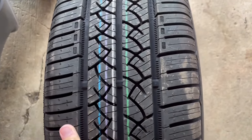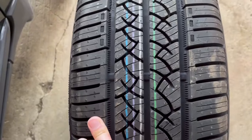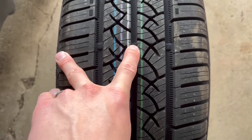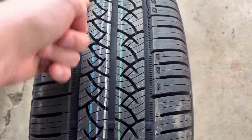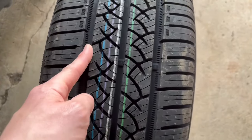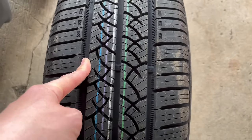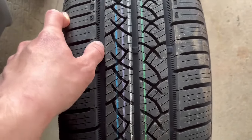When doing a visual inspection — if you're not sure whether you need new tires and you don't have a gauge — you can do this with your eyes or even take your finger and feel around until you find that wear marker. It's just a little notch that sticks up inside the groove. If the tread is still higher than that wear marker, you're probably still good to go.